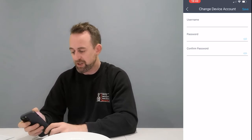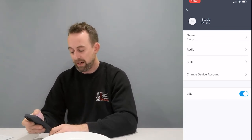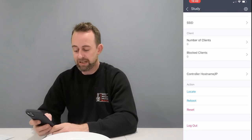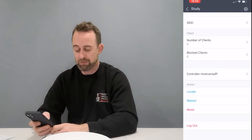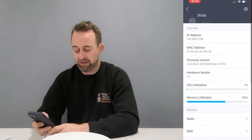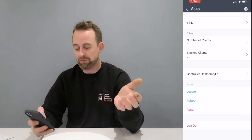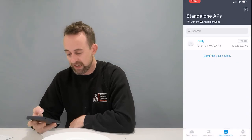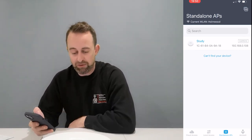The LED option is quite useful — it turns off the blue light on the front if you've got the access point in a bedroom, for example. The locate function is handy if you've got five or six of these — press locate and the blue light on the front will start blinking so you can identify which physical unit it is. Reboot is useful if you're having issues, and reset will factory reset it — useful if you've forgotten that admin password. That is essentially the standalone mode setup.